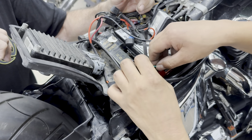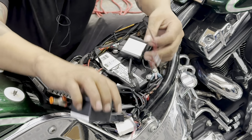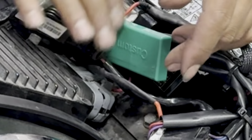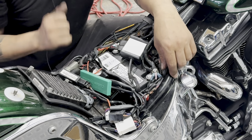Okay, so earlier in the video I spoke about our inline 20 amp fuse, which is going to our dual relay module. That's where this inline fuse goes to. Now, we also had another power and ground that we brought in from our instant up box. This power and this ground is going directly to the battery. So instead of having to run another inline fuse, you can bring that power wire up like I did. I trimmed from that inline fuse, soldered and heat shrunk it in. So now I have two powers coming out, and they're both running off that same fuse, which is completely fine. Now the ground, I did run a completely separate ground, which is this one right here, and I connected it onto the terminal.